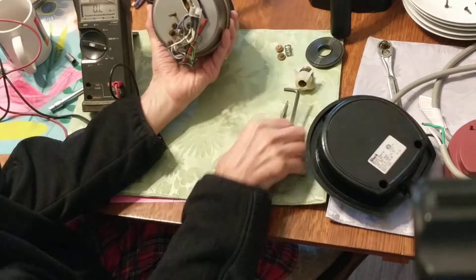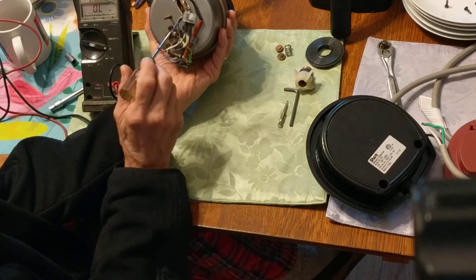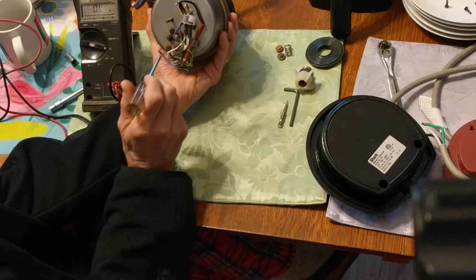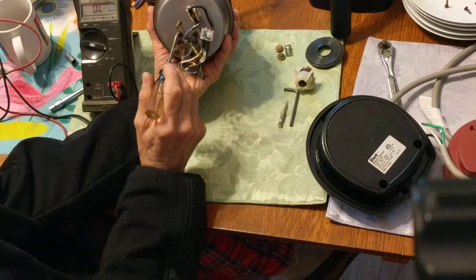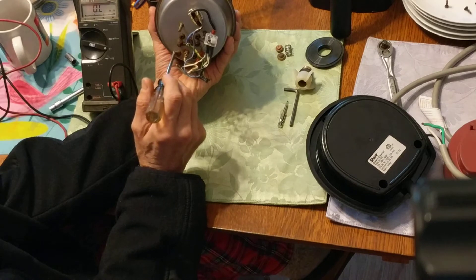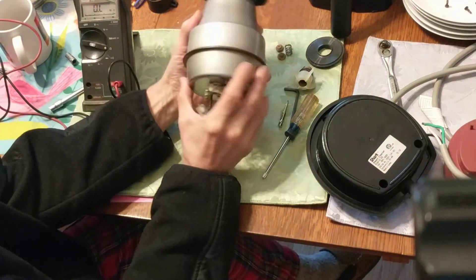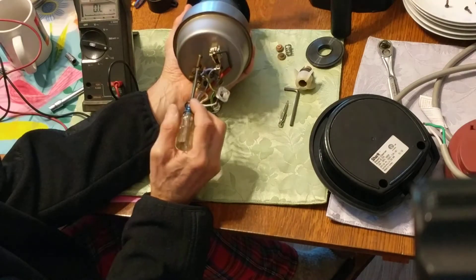Once this starts to be used again, if there is wetness — and there probably will be if there's a leakage issue — you can see that any of these screw positions or this terminal position could be a problem. These screws probably hold in the heating element. I'm not going to unscrew those because the heating element might fall off on the inside and I can't reattach it — this was probably sealed after assembly. Those could be spots where the thing is conceivably leaking. I could try sealing those spots, but unscrewing them might just damage it further.